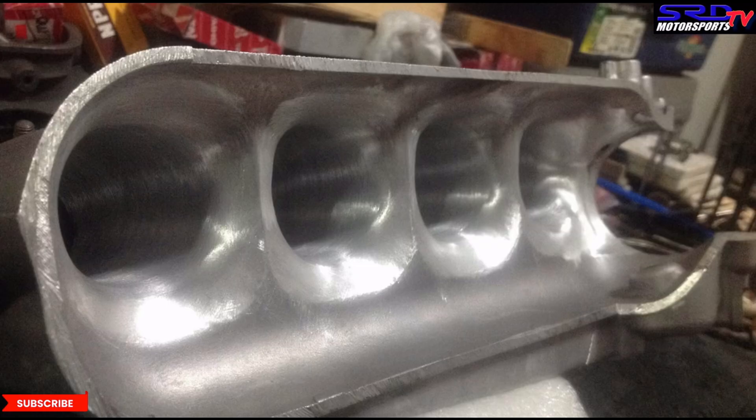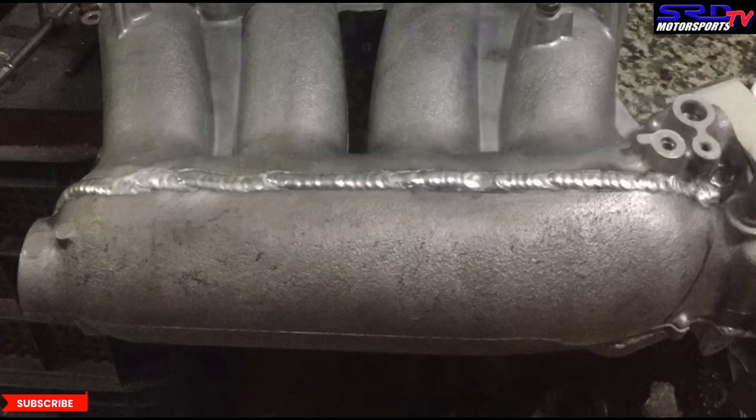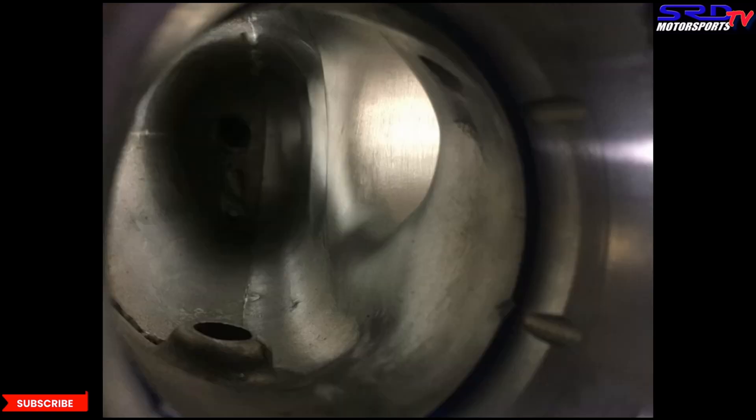That's the velocity-stack-looking runner entry. Next up is the welded plenum. You can actually smooth that so it's not noticeable, but the owner didn't mind. Here's another angle of the welded plenum, and you can see on the runner flange near the head it's all port-matched equally to the cylinder head. The inside look shows the stacks are actually raised from the floor — that's all Honda. That's why the RBC manifold is quite decent in factory form.